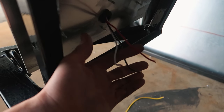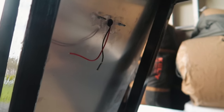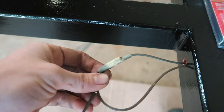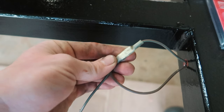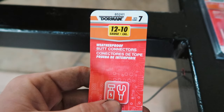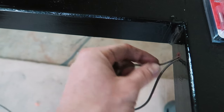For the taillight wiring, we got our ground, brake, and turn. Yellow is going to go to one and brown is going to go to one for tail, then ground to the trailer. We also need a ground for our license plate light and power — that ties into the taillight circuit. These are where the powers for the marker lights join — so this is the wire that comes from your connector from the truck, and each of these wires splits out to your marker lights. I used weatherproof butt connectors which crimp on and then you heat shrink them, and they'll be inside this tube so they're safe from weather. Little rubber grommets let the wires pass through without chafing on the metal.